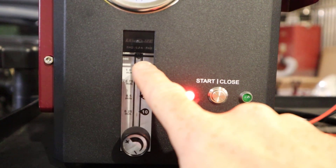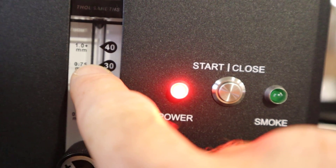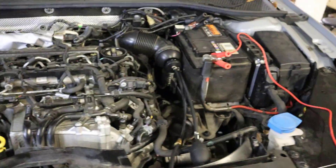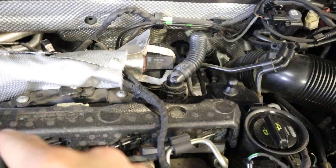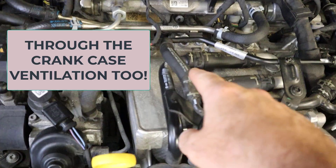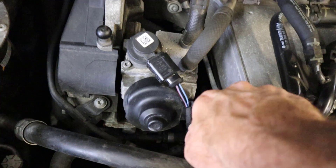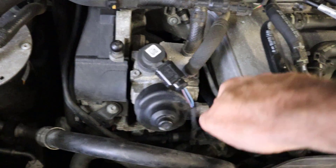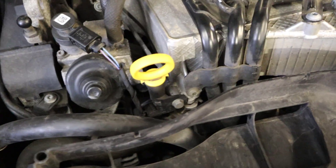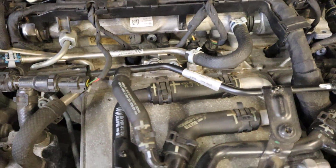The leak flow detector is all the way up there and it's quite sensitive — it's set to pick up leaks that are one millimeter and above. Now we are pressurizing the whole intake system and it's quite likely that there's an intake valve open and we're going into the crankcase. In fact, if we pull out this dipstick we can hear that we just got a load of air pushed out of there. So let's turn the smoke on and see if we can find the leak.